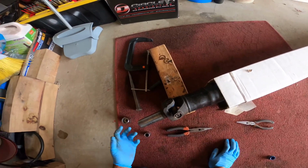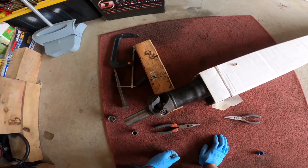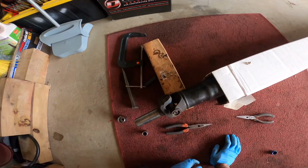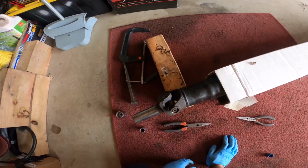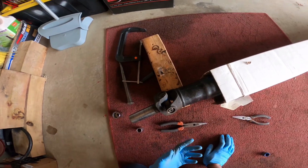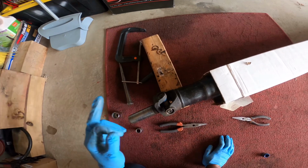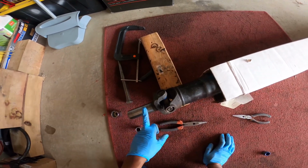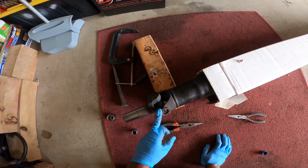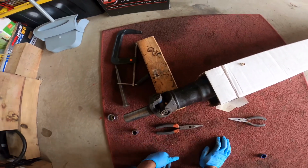It was very obvious because I tried to slide the cap that Ford Racing gives you over the aluminum on this one, and I couldn't get it over. And I'm like, yeah, it'll be all right. So I took the car out, and you saw the video. It had some bad vibration, and it actually was leaking out of the rear seal of the transmission. That's because this spline is thicker. So I gotta get this one over to the Ford Racing one, take the Ford Racing one out.